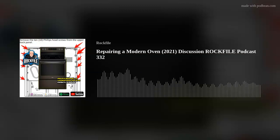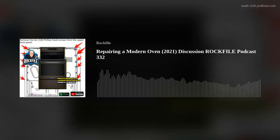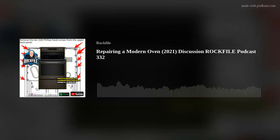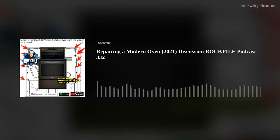For $19.99 and free shipping with Amazon Prime, in two days the switch arrived. You basically take the back cover of the stove off, unscrew the two screws holding the potentiometer — the dial — on the front, pull that out, unplug the two wires connected to the switch, put the new switch in, plug the two wires back in, put all the screws back in, and you're done. It was really that simple. Turned off the breaker, unplugged the stove, pulled it out from the wall, took the back off, replaced the potentiometer. The OEM part from Amazon was an exact carbon copy — same model numbers, same everything. Already saving $60 off buying it directly from Whirlpool. Popped the new one in, put it all back together, plugged it in, turned on the breaker, and the lights didn't come on. The stove was working properly.